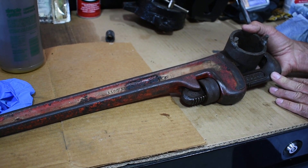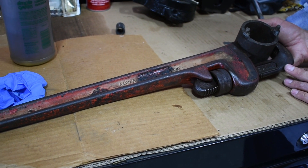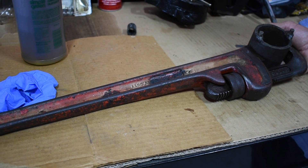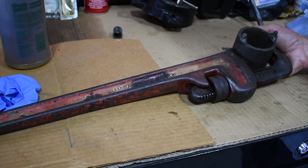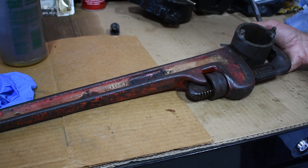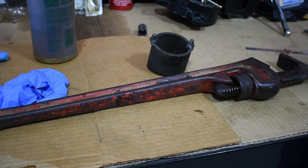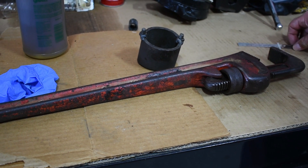Just a quick note: if you go to do that job, you are going to need a tool like this. There's also another special tool you can order online — not too bad a price. I actually wound up having to order two because the first one I got did not fit in my variable valve timing solenoid port. Out of the two kits I got a gear holder from one and a variable valve timing holder from the other. Be careful who you order from — there's apparently some hit or miss on those. But those are two special tools you will need for the timing chain replacement with the tensioners and everything.